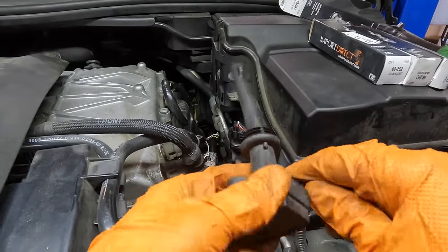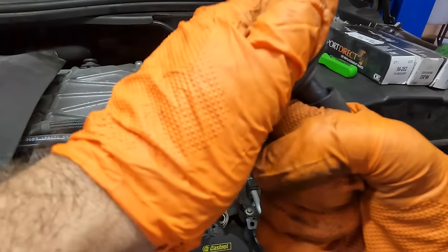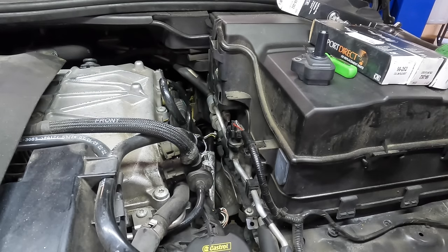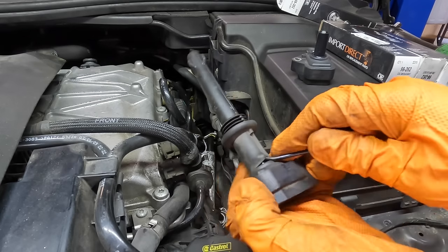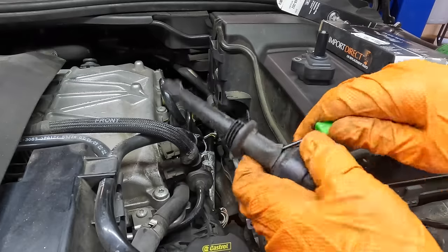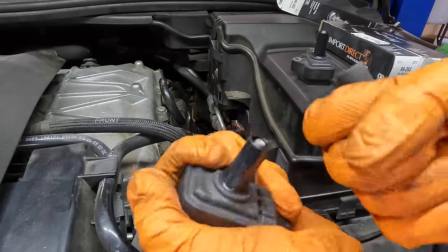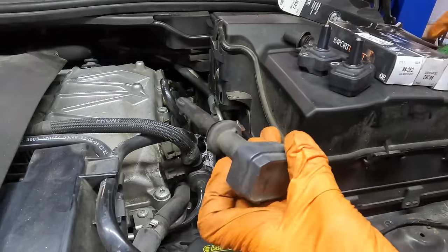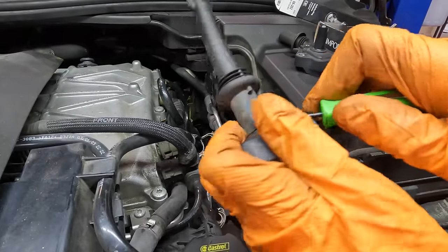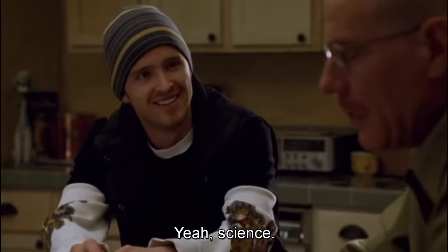Same procedure with the rest of these guys. We'll get behind them with a little screwdriver, break that surface adhesion, and separate the coil from the boot. You could probably try to grab it with pliers and just twist it, but you run the risk of breaking the plastic on the coil, which is very costly. Twisting helps — once you generate some motion, there's no longer contact on a micro level. No contact means less friction and it helps the thing slide off. Science!